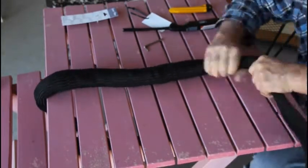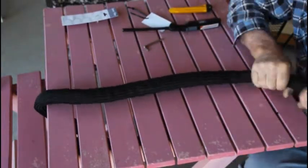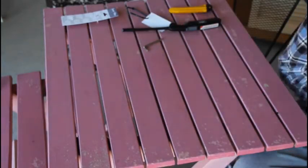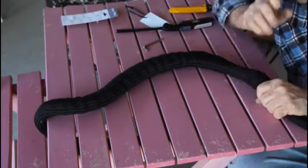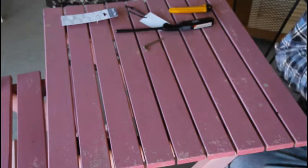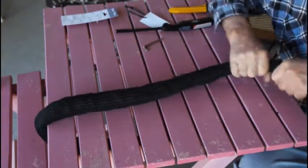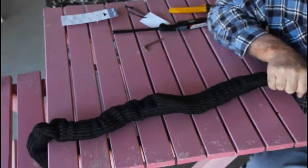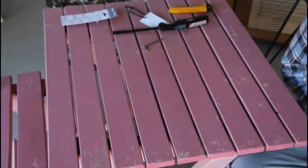And that's exactly what I'm doing here — I'm pushing the chain guard onto the chain rather than trying to pull it onto the chain. By pushing it onto the chain I expand it, make it a larger diameter. It slips on really easily and you just keep working your way down the chain pushing more of it on. Yeah, it sounds pretty tedious but it really doesn't take all that long. If I was doing it for a living I'd want to find an easier and quicker way, but just doing a one-off every now and then this works just fine.